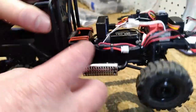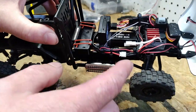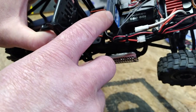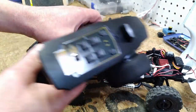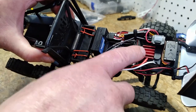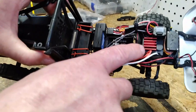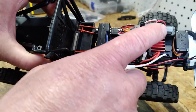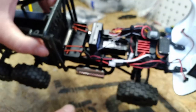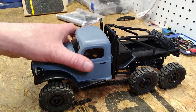The stock driveshafts do slide directly onto that transmission, and I came up with a way of bolting it in with minimal modifications. I had a Turbo Racing receiver already, and that receiver is compatible with the stock transmitter. I also had this Hobby Plus TB60025 ESC — I purchased it for $14 for another project but never used it, so it was a perfect fit here. It's a good little ESC for the price — pretty smooth, pretty quiet — and after installing this electronics package I was pretty happy with the slow crawl and overall performance.